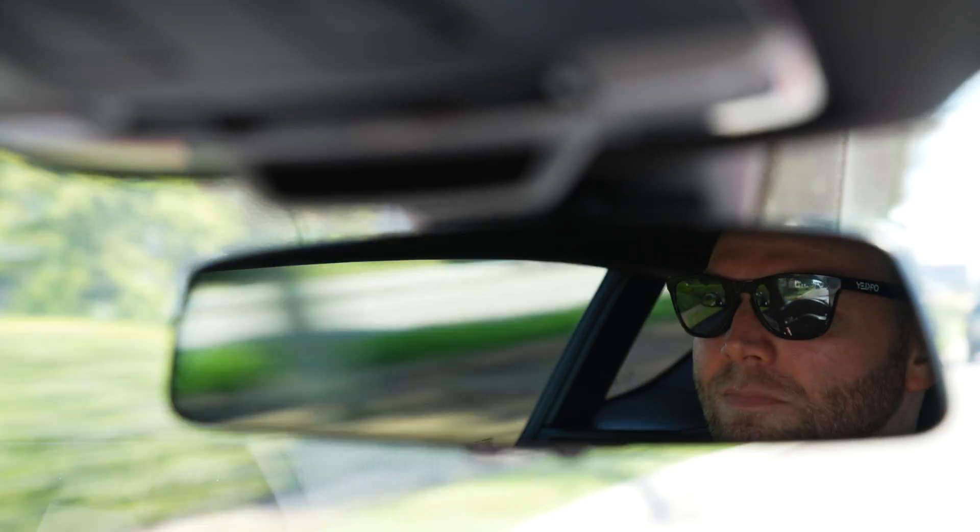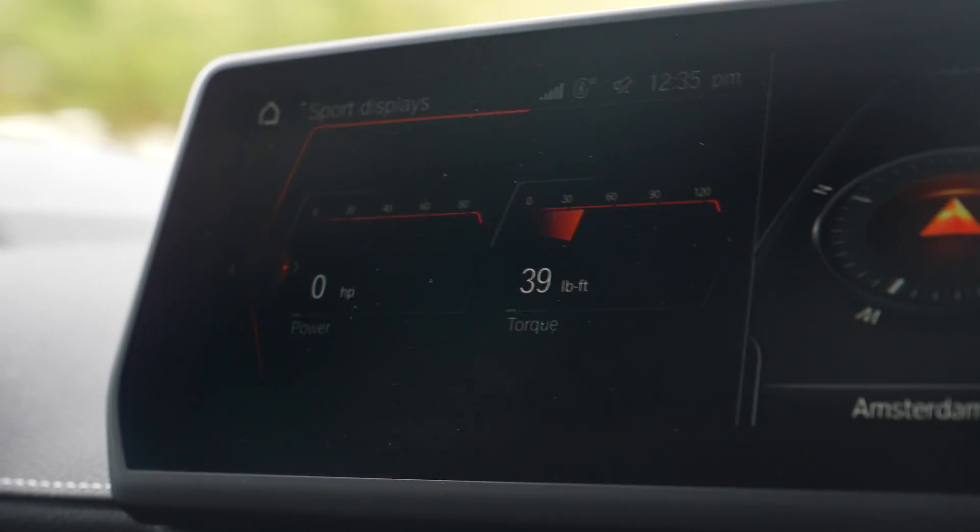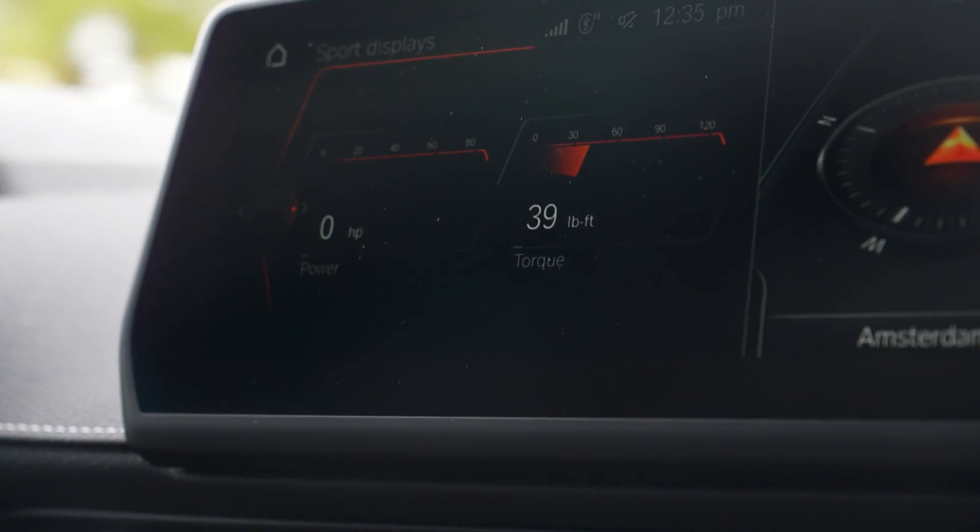And as you can see, there's no concern about driving the car while the content is in flux. After a short drive, the fuel is properly mixed — and it looks like we're landing right at 39% ethanol, back to 520-ish fuel horsepower.